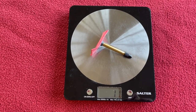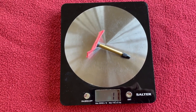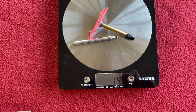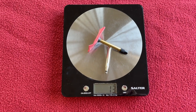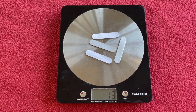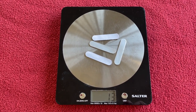So we're up on the table where I normally weigh everything. We've got the rear valve extender I'm going to use - 11 is the base, so that is 14, and that is 13. So 14 grams for the rear, 13 for the front. This is on the cusp of being 13-14 grams, so we're going to use four weights for both wheels - just makes it easy.